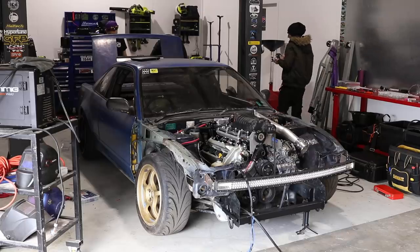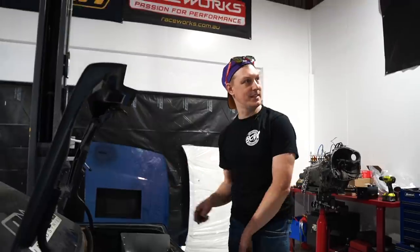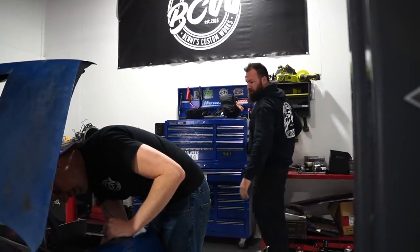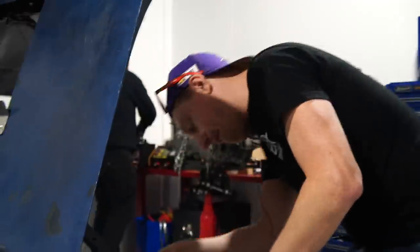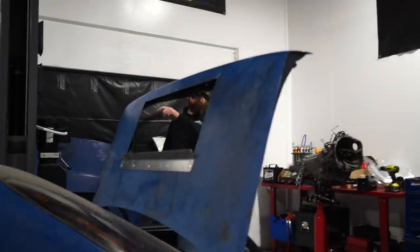Well, now that you've done your thing, I can make it work. And then I'll just get you to fix the fuses. And I reckon that power is literally because I've just whacked it onto the starter, because I've picked up power from the starter post. Yeah, because it said starter on it. But I did think it was odd, because I reckon that wire is literally teed into what you've got fused.